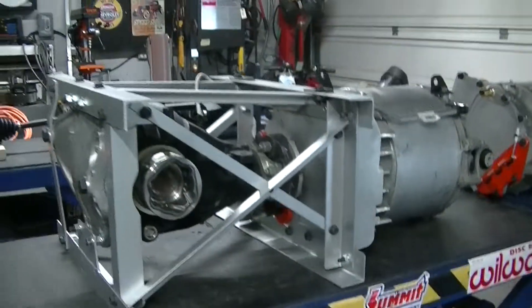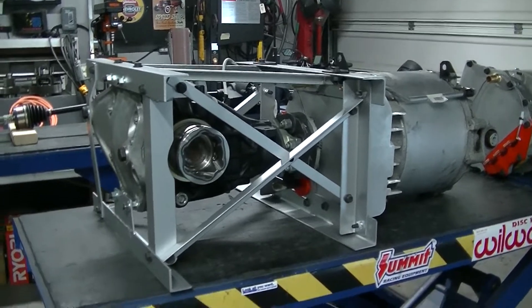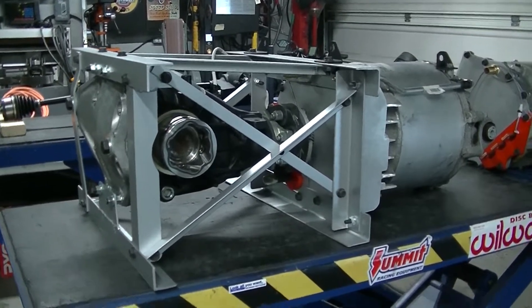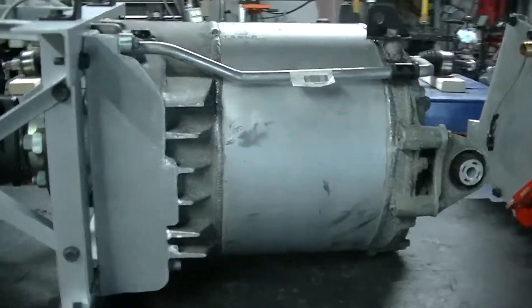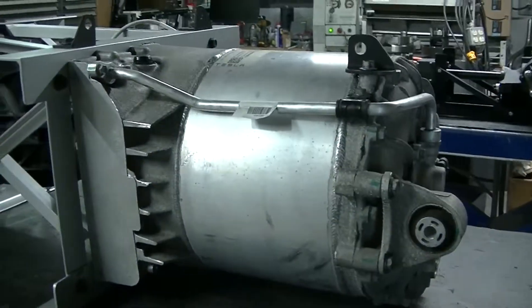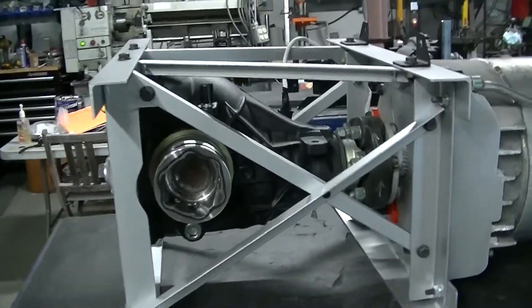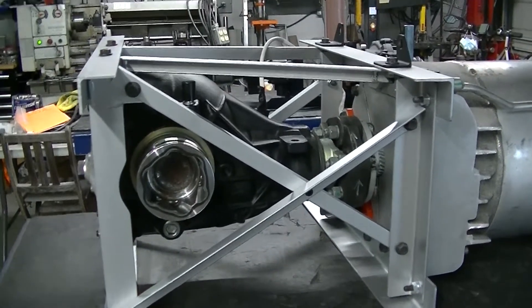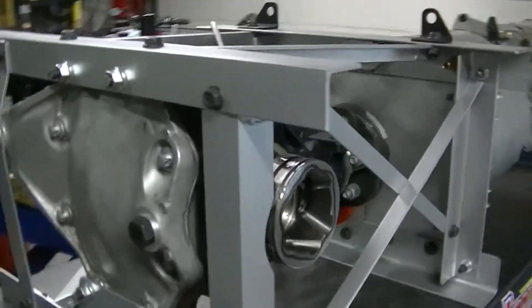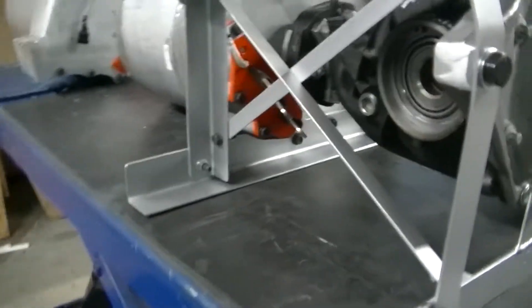If you remember from last time, I talked about a four-wheel drive Tesla-powered rally car. So I just thought I'd show you my setup — I just finished this the other day. This is the Tesla motor, the large drive motor, split in half. It's the Dodge 307 differential that is welded, so it's a locker — locked up right now, welded diff.